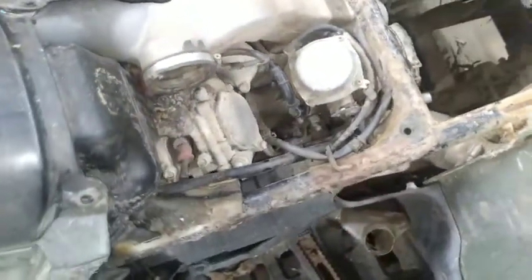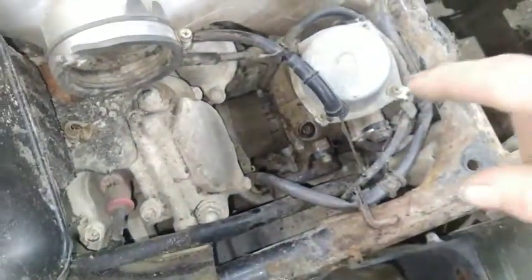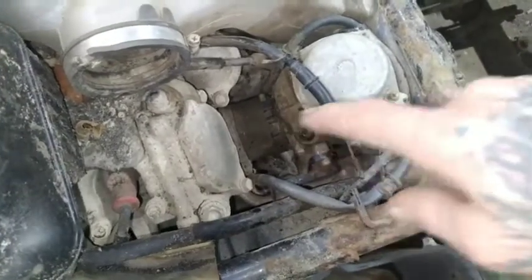All right, we got the air box out. Get to the carburetor, get this pulled off. Nothing's dirty, needs to be clean — the little boot was a pain. So this is the reason why it hasn't been running for quite a while. This part's fine, that wasn't the problem. The problem was the choke broke, so the cable doesn't sit there anymore to pull it up and down — it froze in place. That's why I got a brand new carb. Got the gas draining in the tub, carburetor off, I think it's unplugged.